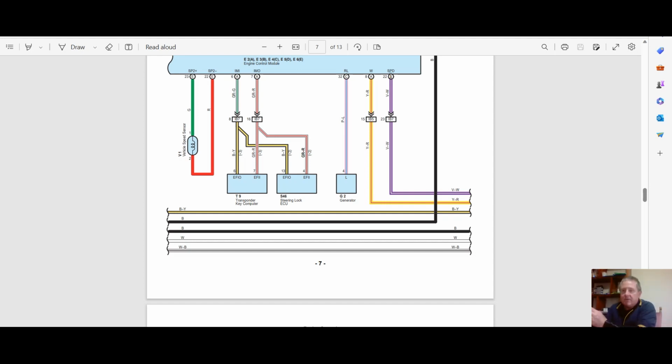We know it's pre-ECU that the problem exists. We're working out that it's going to be ABS or something like that that's causing this problem. And of course my mind's been churning while I've been doing this video, because that's how my mind works. And I ask myself, hey, does the speedo flick at any point? And it may not. This particular fault may happen so quickly that the speedo does a flick and that's all you get, and you can't physically see it, or it's really easy to miss. So that's why these guys will be scoping these wires.